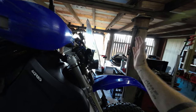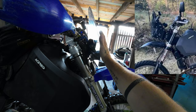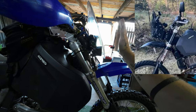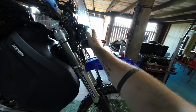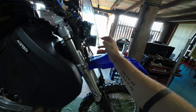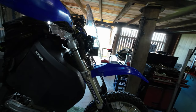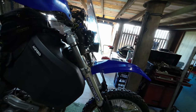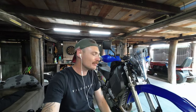I did look at the ARX rally tower and the Links fairing and the Safari fairing when I was toying around with the idea of doing this. The main reason I didn't go with those options and went with one that's actually mounted to my forks is I like having my headlights and everything crammed nice and close to the bike. The ARX rally tower, from those that I've seen, tends to hang out about here. They do mount to the stem, which lightens your steering a fair bit. But three bits of alley, a piece of plastic, and two tiny spotties are a hell of a lot lighter than all the steel that makes up the old headlight assembly anyway. So I definitely save some weight, and I don't notice it's terrible on the steering. I've ridden with bare forks and it feels exactly the same.